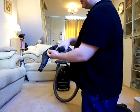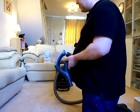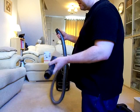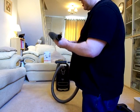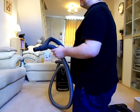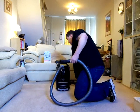The Revolution models had a series of copper slip rings and contacts on the end of the hose, which over time would build up dirt and cause the floor head to keep cutting out in use — you'd be going along and all of a sudden the machine would cut off. What Miele decided to do on this one is get rid of all that, use a standard hose with radio control instead, which I think is a much better idea. It also means the hose swivels properly at both ends. I've got an S5 Revolution upstairs, and when I got it, it was faulty and I had to repair and clean all the slip rings to get it working.